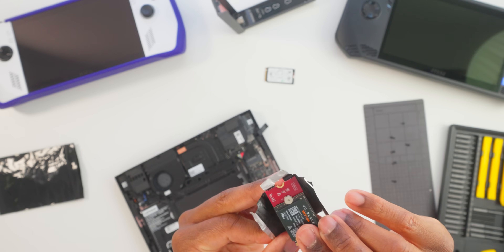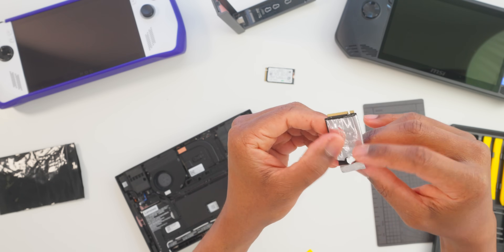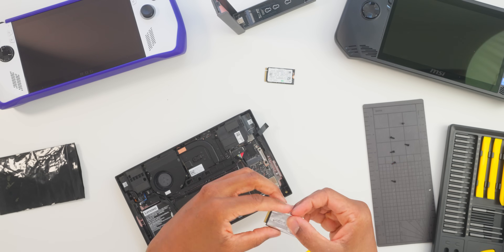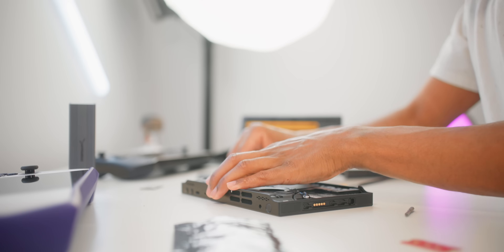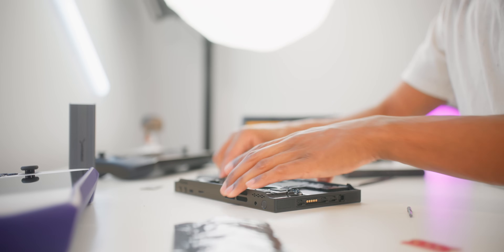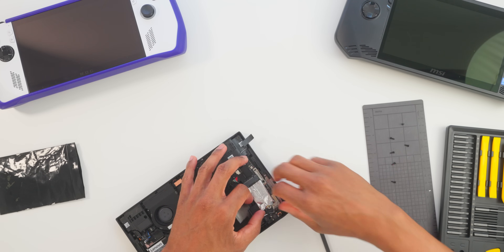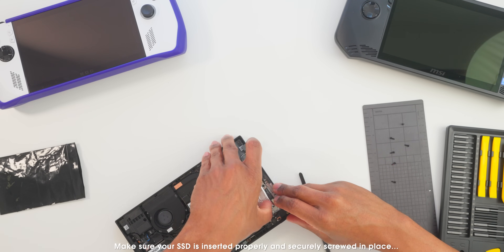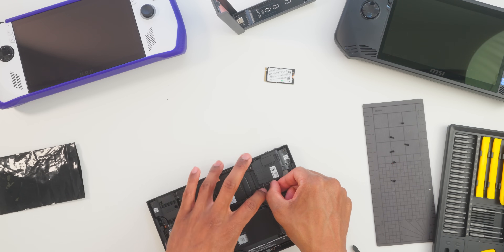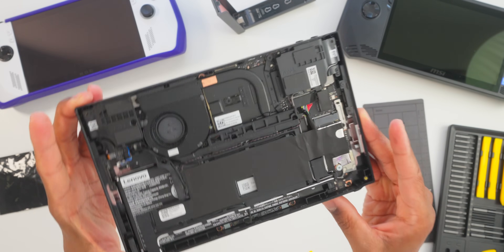Going to place this right inside of here — this flap first, that flap second, and this flap last. Now we have our shield on our new WD Black drive. Let's put in our two terabytes of goodness and get this thing closed up and ready to go. I accidentally hit the power button, so this is exactly why you unplug power first. The insertion is a little different than your traditional M.2 insertion, so just keep that in mind. It seems to be in there just fine. Going to take that tape, place it back on, and now you get a nice inside look at the Lenovo Legion Go — you can see the heat chamber and the fan; it's a really nice, internally well-built device.